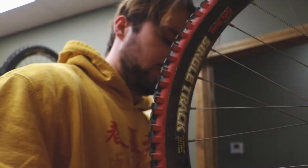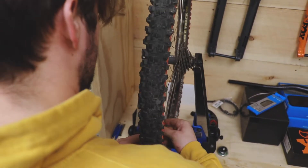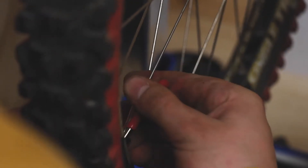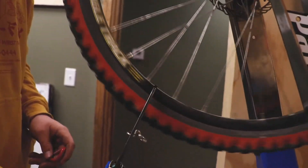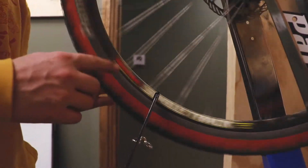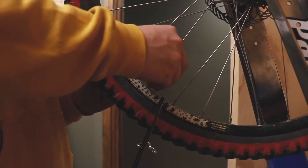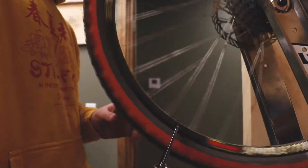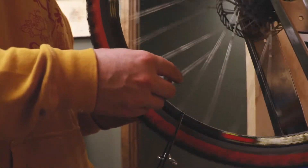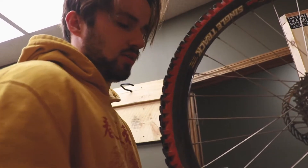This is probably one of the most rewarding things other than building a full bike. I'm barely turning anything. That's a pretty good distance, a pretty good gap between the gauge. So I'm going to start truing again. Now you will just follow these little bumps until your gauge right here is just completely closed, which for me it almost is.